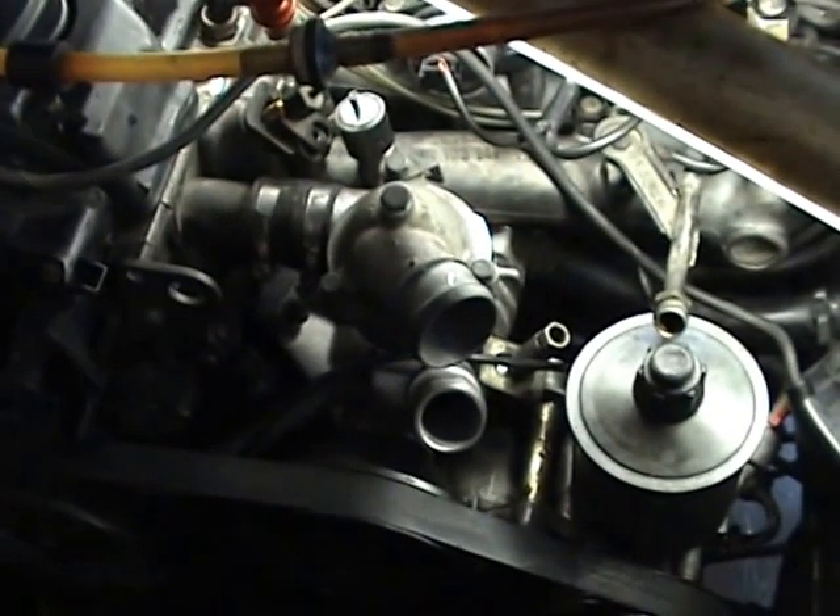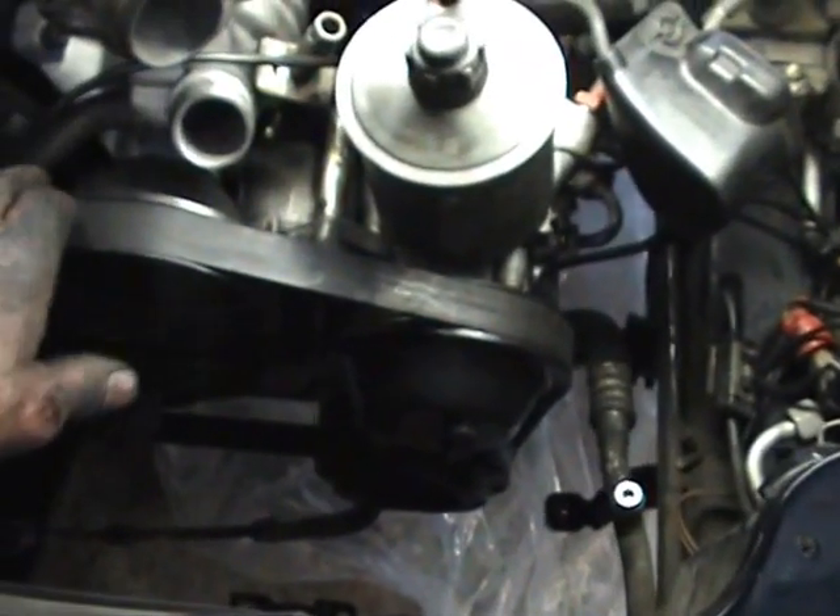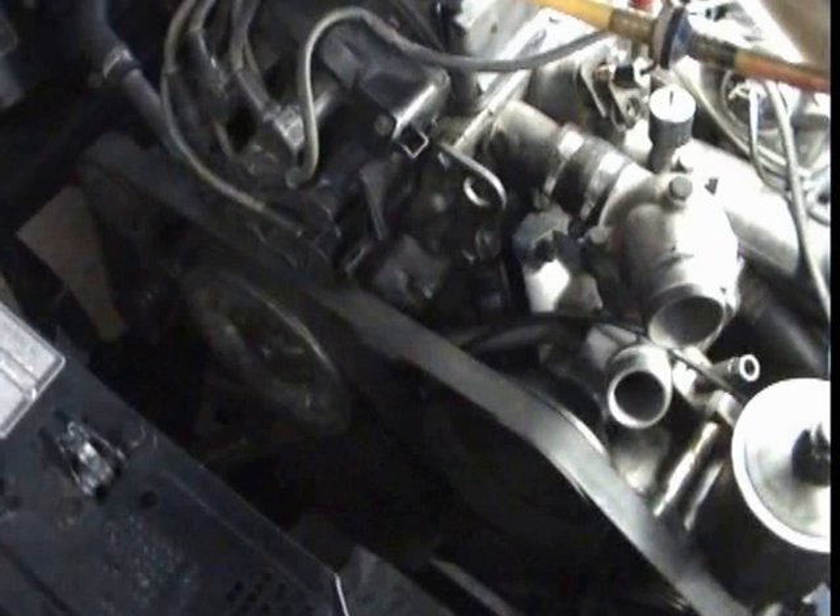I'm putting it all back together. I've got the pump back on, power steering, the air compressor down the bottom, put the pulleys back and got the belt on. All I've got to do is throw the fan on and put the radiator back. I suppose you thought I didn't enjoy myself — well, that was a hundred percent correct. I didn't enjoy myself at all. It took all day to do that job. What I learned from it is don't bother dropping the air conditioner at all. Just drop your power steering unit, pull off the tensioner for the belt, and try your luck from there. I don't think pulling the air conditioner off would make any difference whatsoever. See you next time.